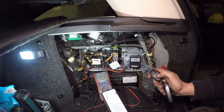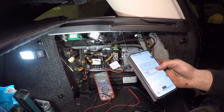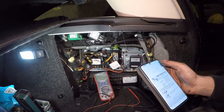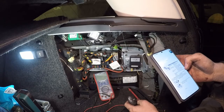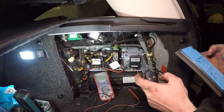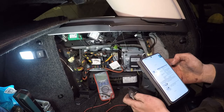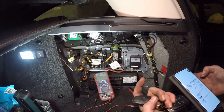Turn off so it goes off. That was way too easy. So whilst we're here, I'll try and put a copy of this in the description. The LED displays: if the green or red light comes on for one or two seconds when you press the buttons, that means the remote is working. If they flash green or red quickly for two seconds, that means it's either too far away or not programmed - which was what I had beforehand. If it lights up orange for two seconds the battery is getting low, or if it flashes orange for five seconds the battery is pretty much dead. But wow - all it needed was to be reprogrammed. So that was easy.